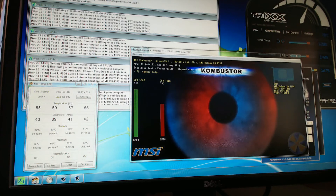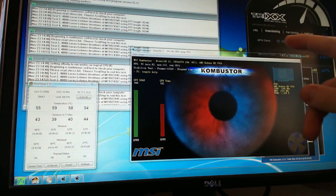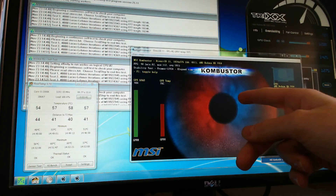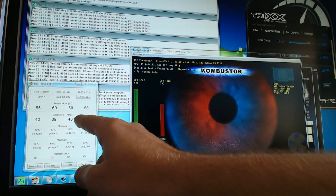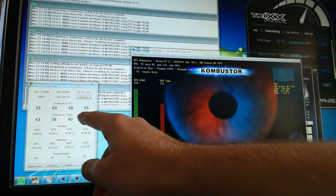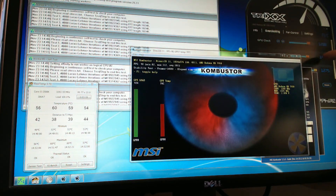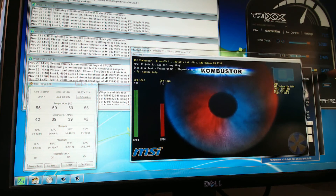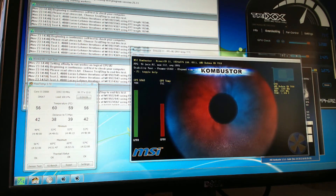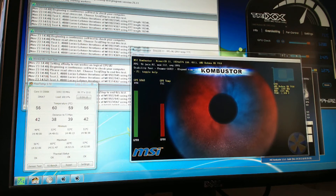So we're running a few tests here. The webcam frame rate will probably be awful because we're running both the CPU and the GPU really, really hard. We've got the GPU up to 70 degrees — it's been running for a few minutes on Combustor. The CPU isn't overclocked but it's running flat out on Prime 95, running at about 60 degrees at the moment. The GPU itself is overclocked to 1.2 GHz, memory clock 1425, and the voltage on the core 1275 — so a fairly hefty overclock from 800 MHz. Although it is running fairly cool at the moment, we'll take a look in the case in just a second.